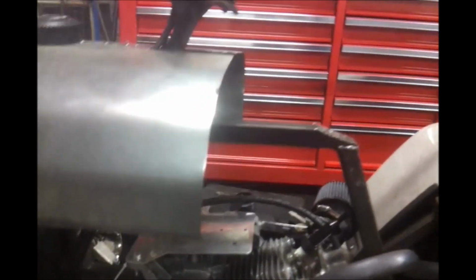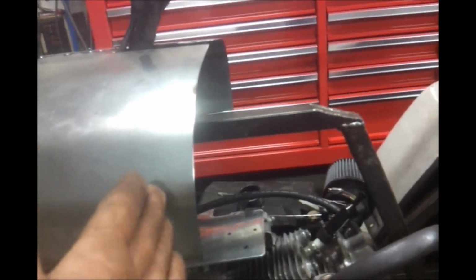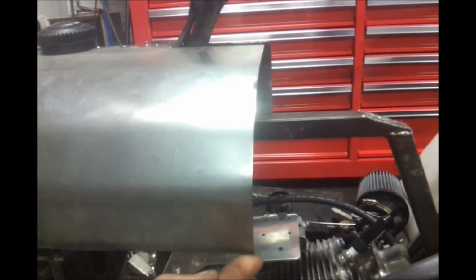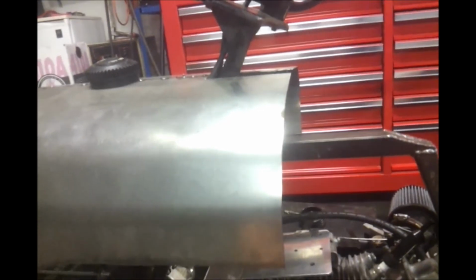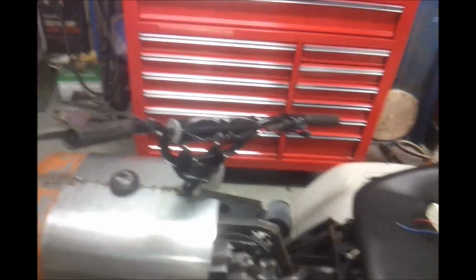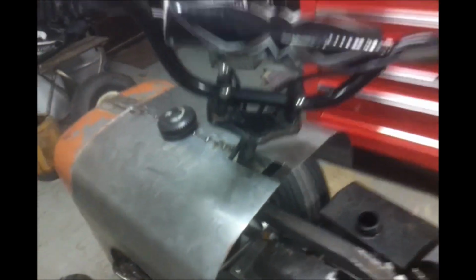And I'm still gonna have to make my dashboard for it. What I think I'm gonna do for convenience is to angle it that way, and I'm gonna measure from there to there and just kind of angle it, and then cut a piece of aluminum diamond plate to put in there. Or I do have a local machine shop in the area, and now I'm not sure if this is exactly what they call it, it's engine turning. It's where they take a wooden dowel with valve grinding compound on it, and with a milling machine they'll just polish the entire thing. It looks really cool. So I might go with that. I'll get my holes drilled, bring it out there, and have the guy engine turn it. And also once I angle it, it'll clean up this hole a lot, so I don't have to worry about making it pretty, because it'll kind of make it pretty itself.